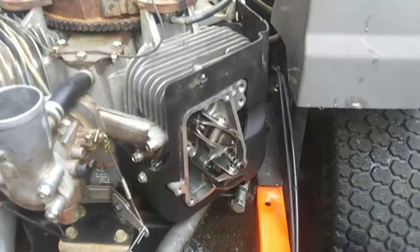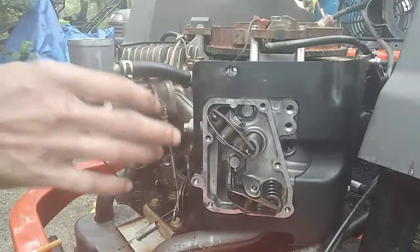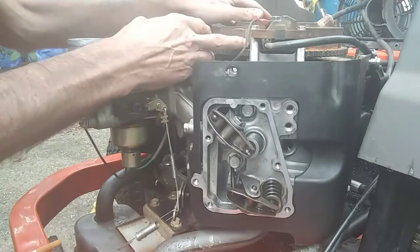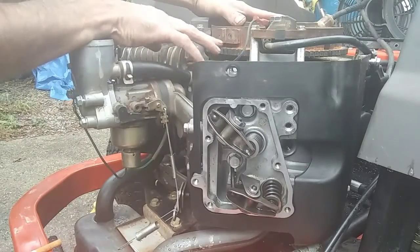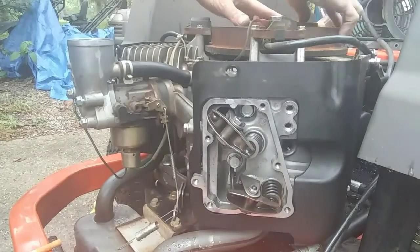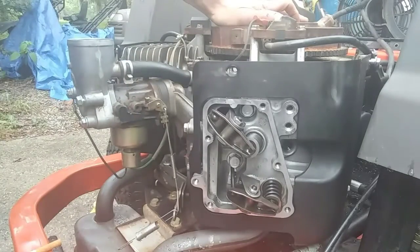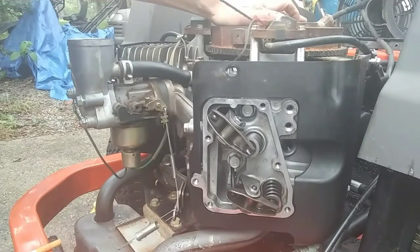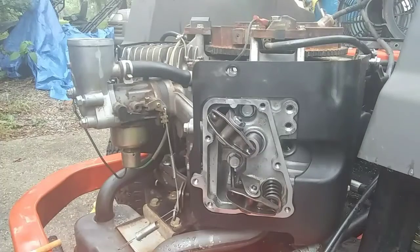I've seen this on a couple of videos but I thought I'd show this to you. Basically, if you want to know, you have a top dead center on here on the Kawasaki. I don't know if you can see my fingers up here, but this is the flywheel — I'm going to spin it around. These are the two magnets. So you spin this around, and the service manual says to line this left arm — if you're looking at it from behind the engine. On the diagram in the service manual they're looking at it from the front, so it kind of looks weird. But you want to line the second magnet up with this leg of the coil right here, and that's going to be supposed to be top dead center.